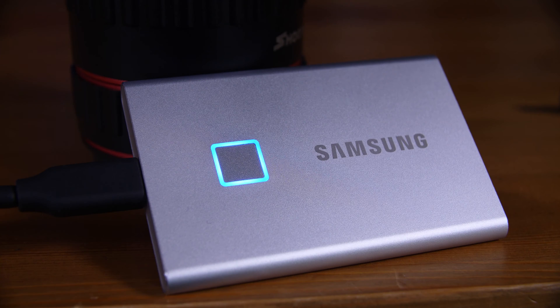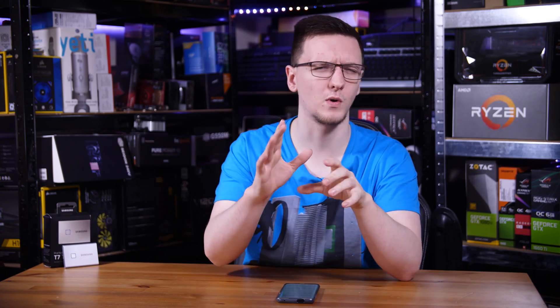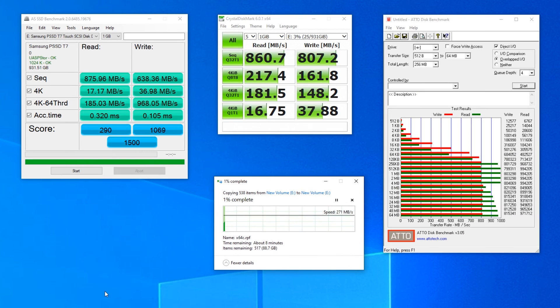So it's reasonably secure and impressively easy to use. But does that security slow the drive down? Happily, no — it's still bottlenecked by the USB-C 10 gigabit per second connection, but it's impressively fast. Samsung claims up to about a gigabyte per second reads and writes, although in my synthetic tests I saw reads getting anywhere between 800 and 900 megabytes per second, closing on a gigabyte per second depending on the setup. On the writes it was more like 700 to 800 megabytes per second, which still isn't bad, but not quite what Samsung was claiming.